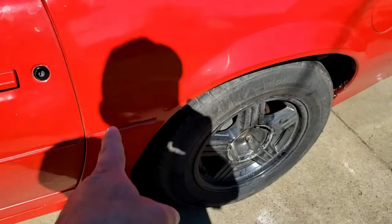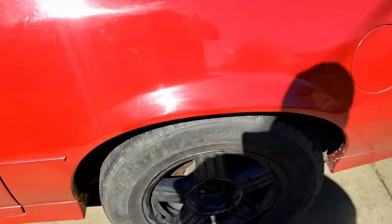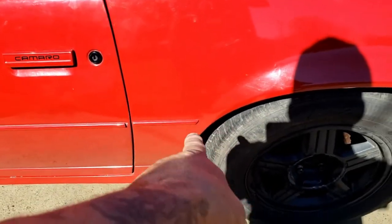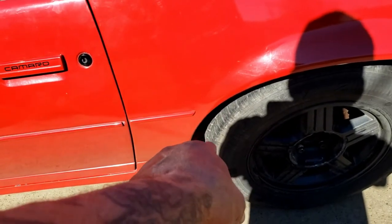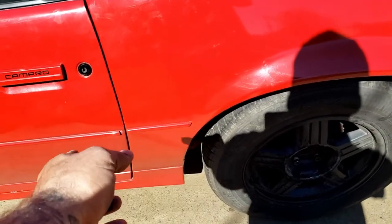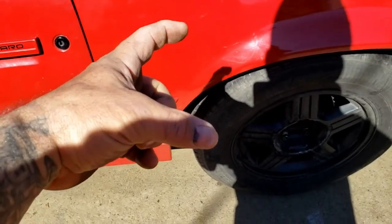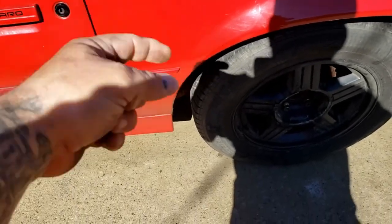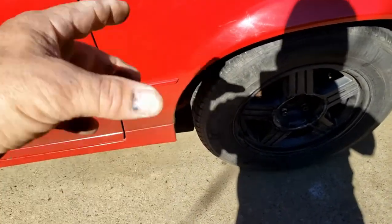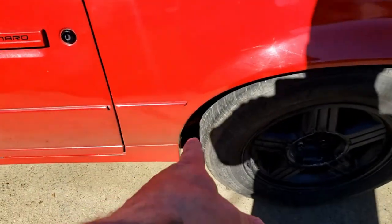And then I do the same thing back here, but I work it so it gets to the trailing arm and ties in. So what happens is I end up extending the bolt for the rear trailing arm, control arm, making it longer, getting a nice grade 8 bolt so that it goes through the frame, subframe tie-in all the way over to the trailing arm, whatever. I'm losing my mind here.